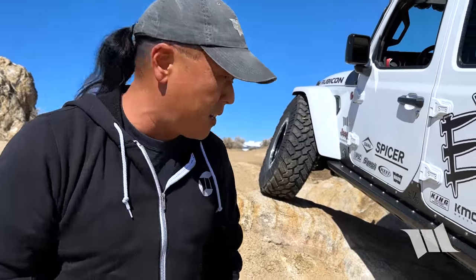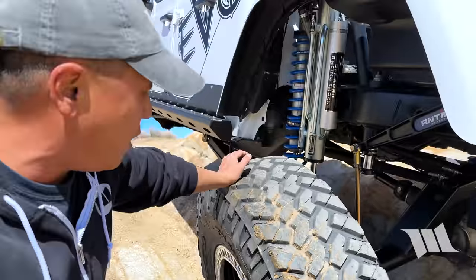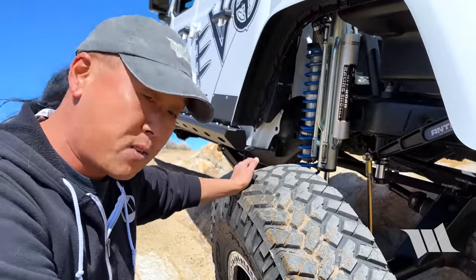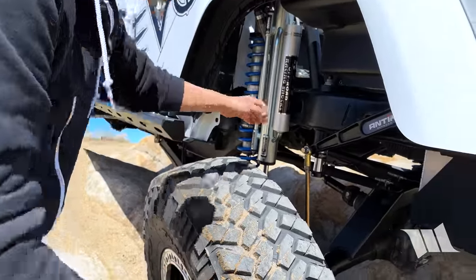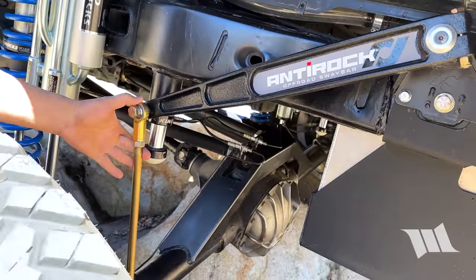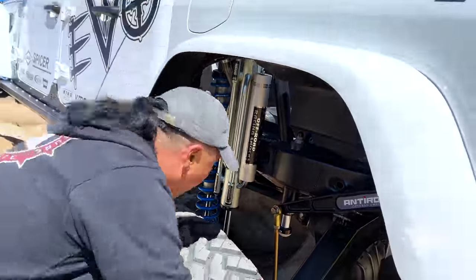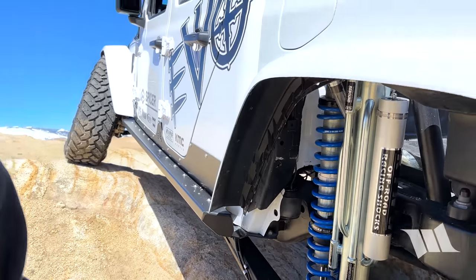Let's give things a look. We're probably not as flexed out as we could be, at least on this first part of our ramp. But you can see we're not having any issues with our sway bar links drooping out — there's plenty of angle in it still. Lots of good droop here. Let's check the other side.